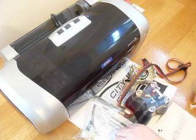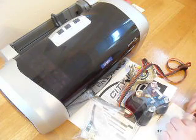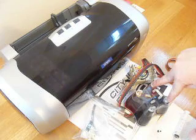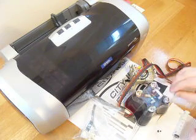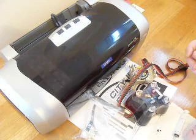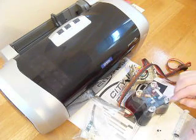One of the other things you have to do for our systems before you install it is the air balance chamber. These four plugs here are your refill holes. When you want to refill the system, you just take this plug out and either pour it in if you've got a steady hand, or you can use a syringe and inject it that way. These four inner ones are your air balance chambers.